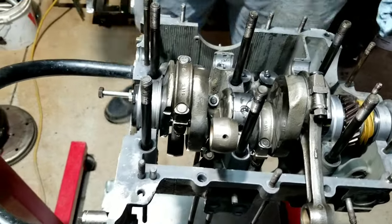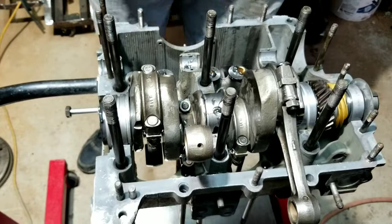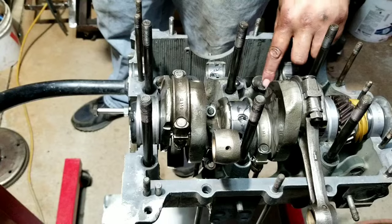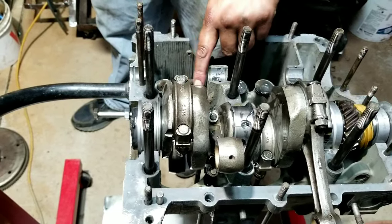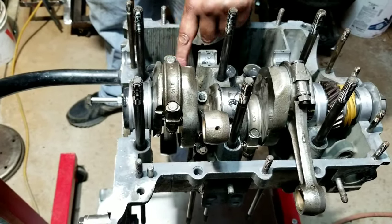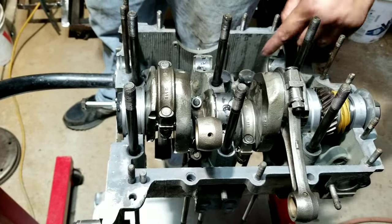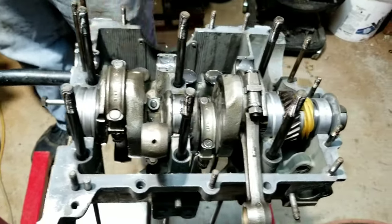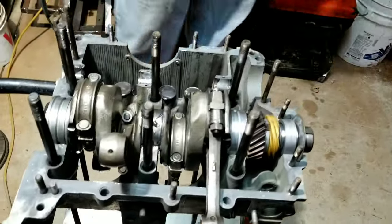I'm not going to say that this cam was in absolutely cherry perfect shape. Some of them I know were perfect, but this one came out of the 1835. There was just a little tiny bit of lifter wear, probably because it's single relief. But for this engine, we're probably figuring maybe 20,000 miles out of it. If it lasts longer than that, it's a hope and a prayer. It's just something we're putting together to make it run, like having a running engine. So might as well use that performance cam. It'll be a lot better than sitting somewhere.